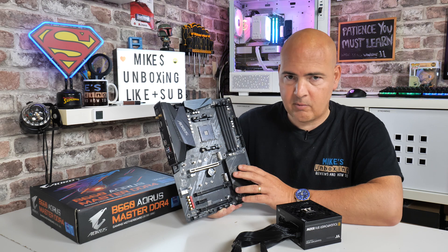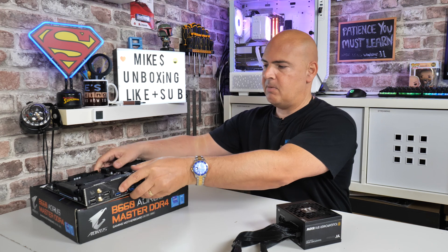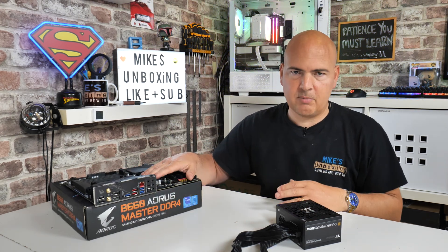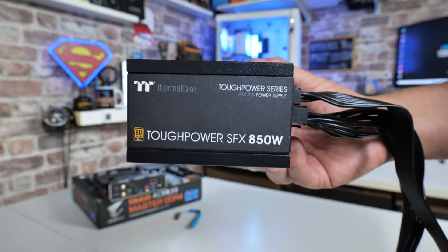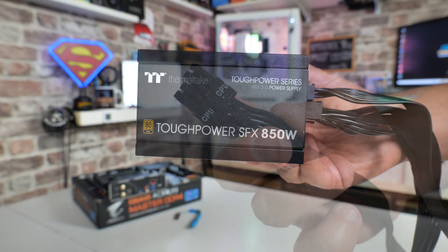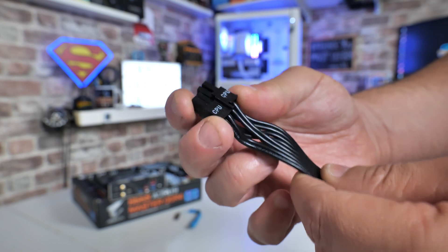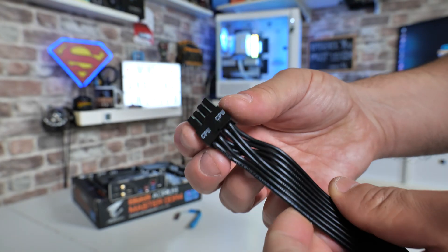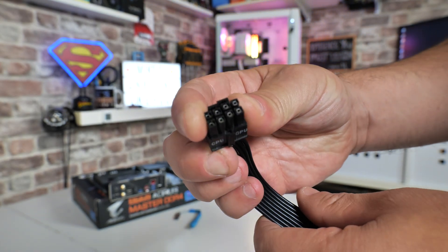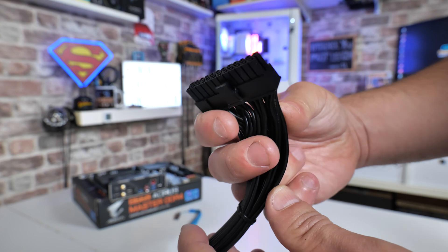There are some things you're going to require to do this. Obviously the motherboard is one, and somewhere safe and sturdy for it to be placed on — I'm going to use this motherboard box for that purpose. You'll also need a power supply; we're going to use this little Thermaltake SFX, nice and handy. You're going to need only two connectors off the power supply. If it's modular, just plug in two. One is the 8-pin EPS or CPU connector, and you'll also need the main 24-pin power connector. Other than that, that is it for the flashing process.